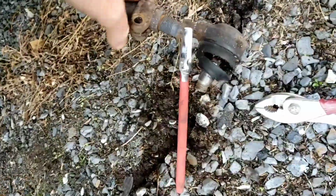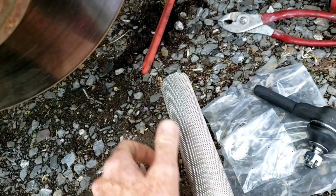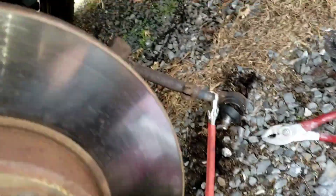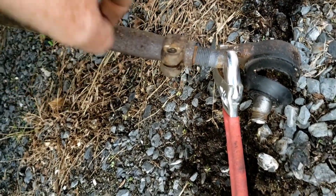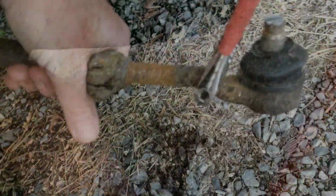What I had to do is put this adjustable wrench over the end of it and then slide my jack handle over it to make it a breaker bar. And I had to stand back and crank it, try not to break anything else back in here. But as you can see, the rusty spots, I got it loose. Oh, and by the way, it spins clockwise. So basically, you would want to turn it towards the front of the car, towards the headlights.